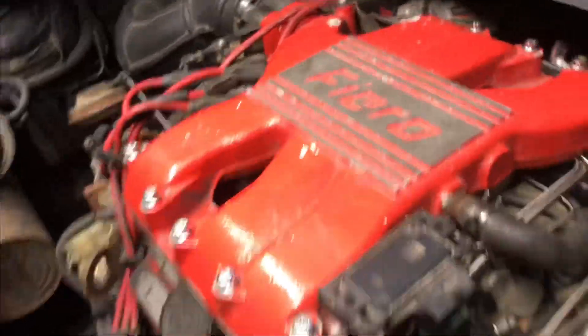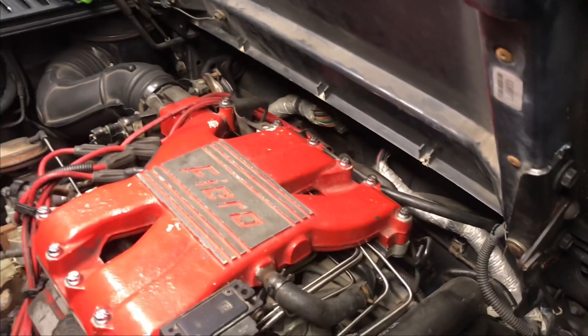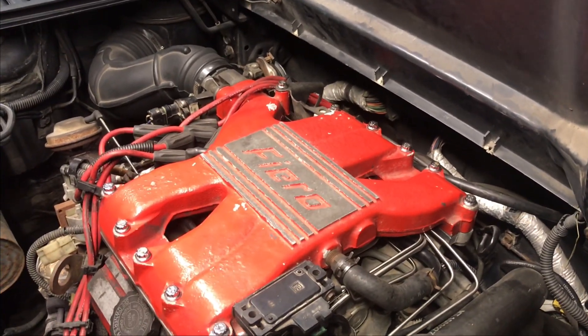If you look right down there, you can see the lines are pretty much perfectly in line. If Ben turns the distributor clockwise, you'll watch that mark move. Move it back the other way — there you go, perfect. This is how you set the base timing by spinning the distributor by hand and using the timing light to gauge those marks.